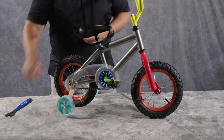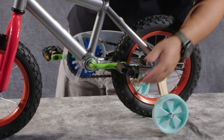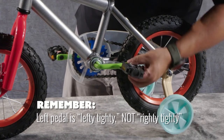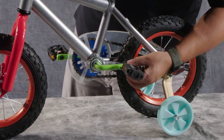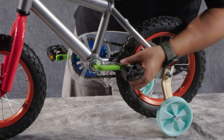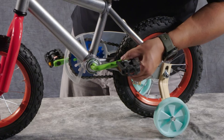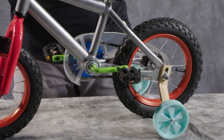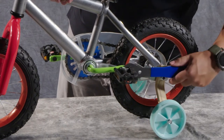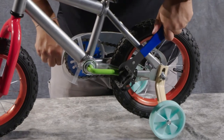The left-hand side — that's the tricky one. I'm going to flip the bike around here. Left side, remember, is reverse thread. So instead of being righty-tighty, like most of us are taught, it's going to be lefty-tighty. Going right like I am right now, I'm loosening it. Going left, I'm tightening it. If you're catching this video and you're assembling one of these bikes, you should notice the sticker on there, but hopefully that helps you out because that's a really common mistake. Let me go ahead and put my Park Tool pedal wrench on here, hold my crank still, and give it a twist to make sure it's tight.